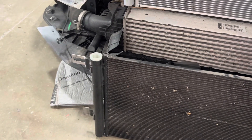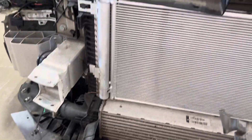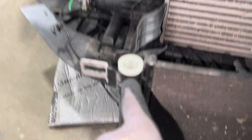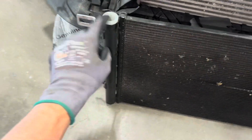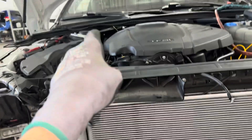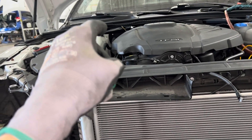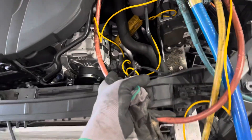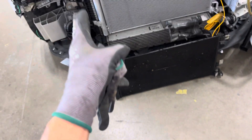Look - from here to up there, to here, to up there. Do you see something missing? This is where you change your desiccant. Every time you service the AC and you have to open up - whether it's a leaky line, a leaking evaporator, an expansion valve not working right, or the compressor was leaking and you had to open up the system - you always change the desiccant material.